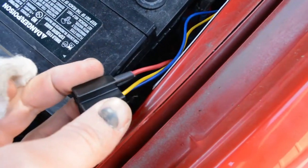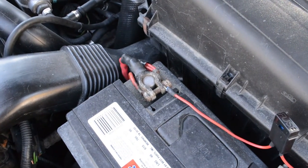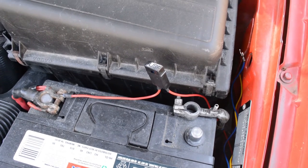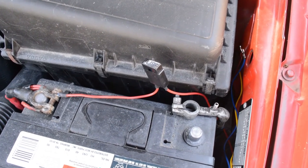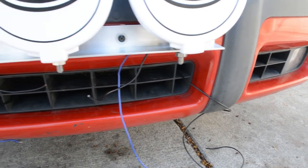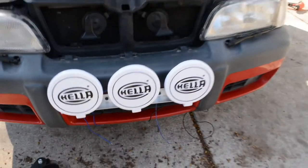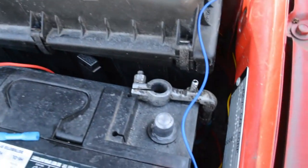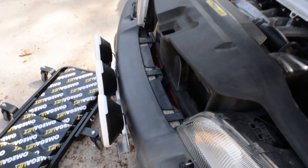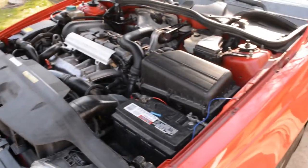Next up is the red wire which is going straight to my battery. The fuse that Hella supplies for the power wire is 15 amps, and 3 lights equals roughly 13.75 amps — so the 15-amp fuse will be totally fine for a 2 or 3 lamp setup. If you're doing 4 lights, you'll probably need to upgrade the fuse. With the lights mounted I'm going to be running the ground wire back to the negative post on the battery terminal for both the lights and the relay, since I couldn't find a suitable ground elsewhere.